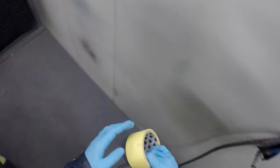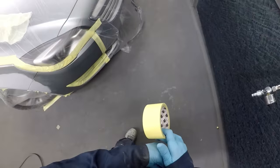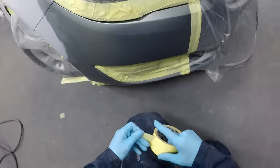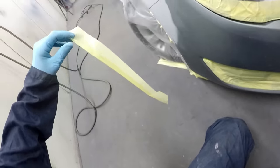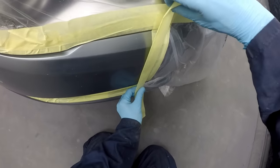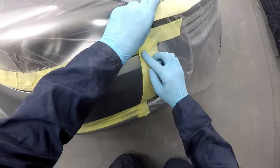Now the panel is clean, we're just going to put a little false edge mask down this bumper edge because we don't want a hard edge there. I don't want any trouble polishing out any blends afterwards, so we're going to do a little folded tape trick straight down this bumper — making sure it goes top to bottom so we can cover that little edge.